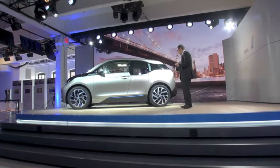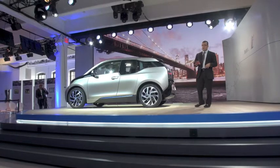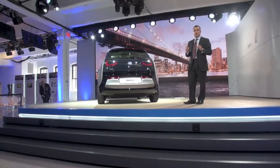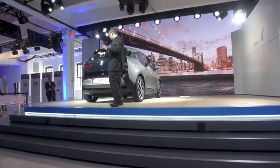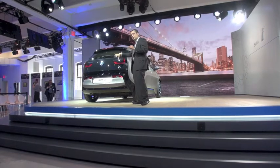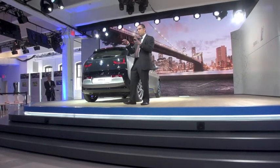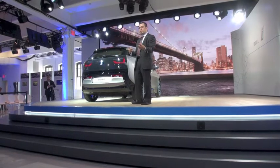As we swing to the corner rear, I want to highlight the lighting effect. We have these floating LED taillights — again, the U-shaped taillight design, LED, part of the BMW i character. The e-drive motor and electronics are all located here in the left rear — very compact, rear-wheel-drive BMW. For the i3 with the range extender, the range extender is located on the right side of the rear. This allows us to have a seamless integrated floor pan that's the same between the i3 battery electric version and the i3 with the range extender — no bumps, no intrusions into interior space, and the same luggage capacity in the rear either way.